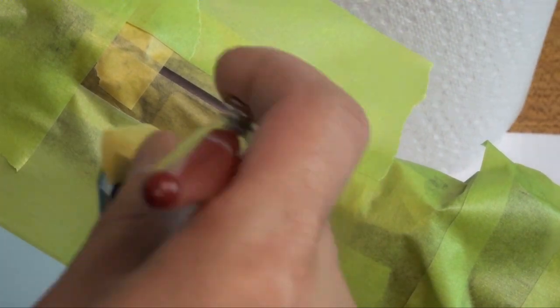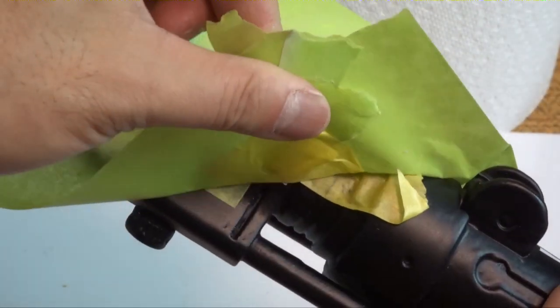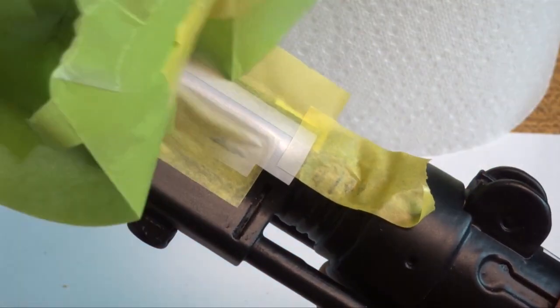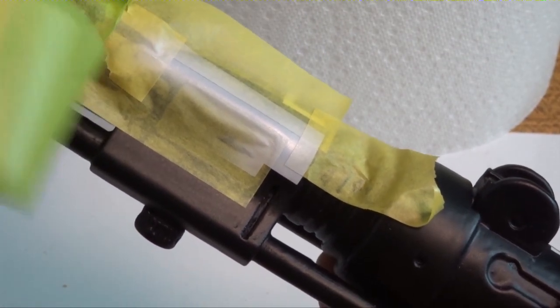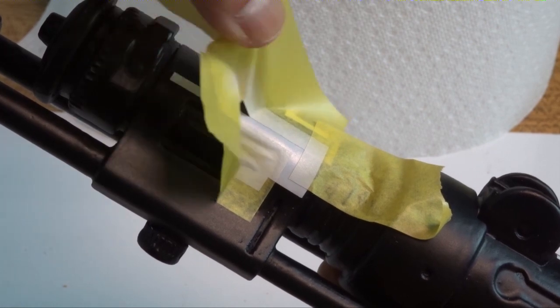So here I'm just finishing off some of the other pinstripe areas in white. Again, being really careful not to lay on the paint super thick. I know the video is sped up, but I'm actually doing 3 light coats to make sure that the paint isn't overly loading the area and potentially seeping underneath the masking tape. You definitely don't want that to happen.